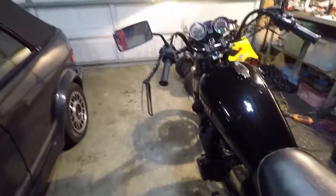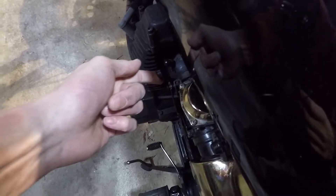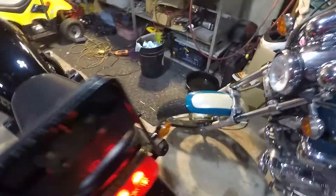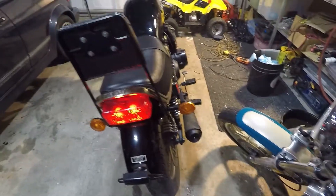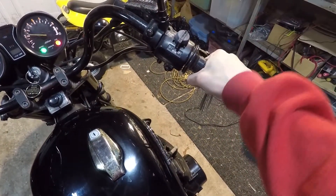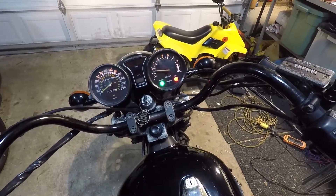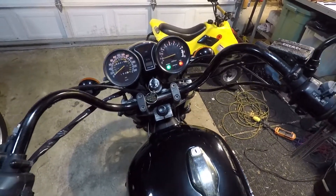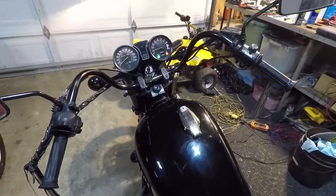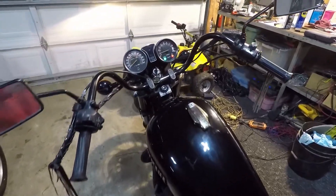It's been running for maybe three or four minutes now. I've taken it off max choke, to mid choke, then pushed it in the rest of the way — now we're completely off choke. It's running well, idling well. Let's give it some throttle. Sounds good, doesn't it? All it was, was those plugged up idle jets — some people call them pilot jets, same thing. Thanks for watching guys, hope that helps you out.